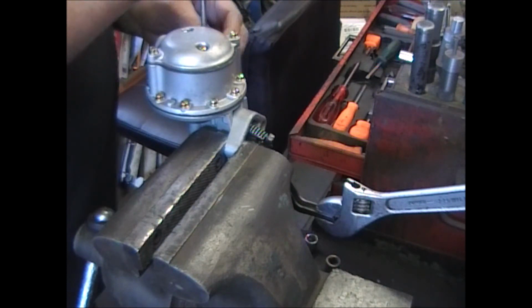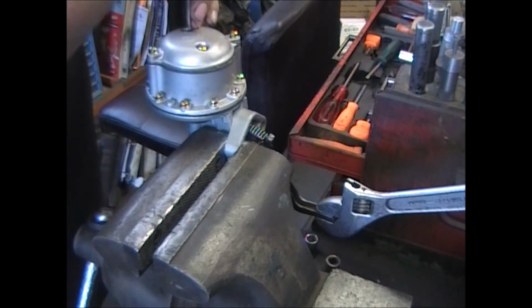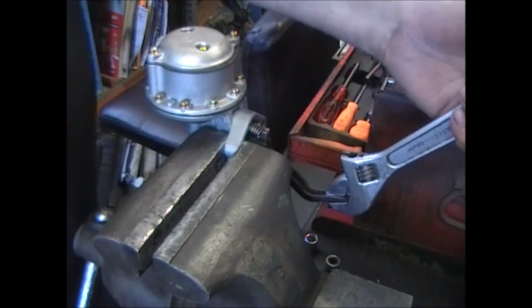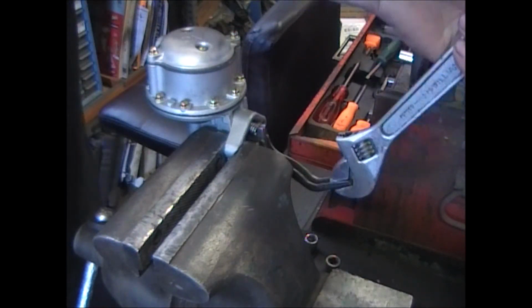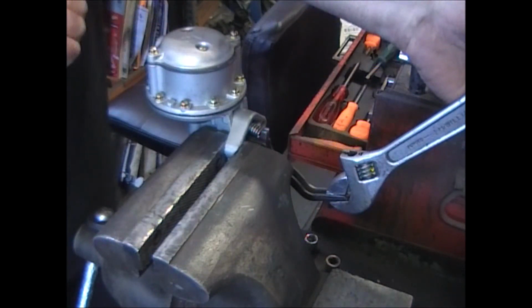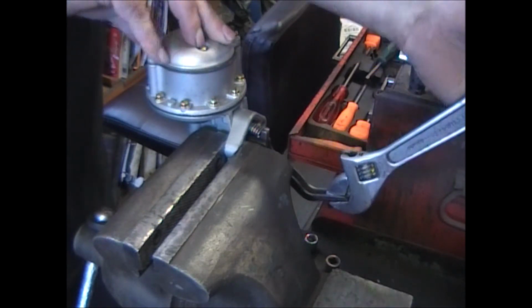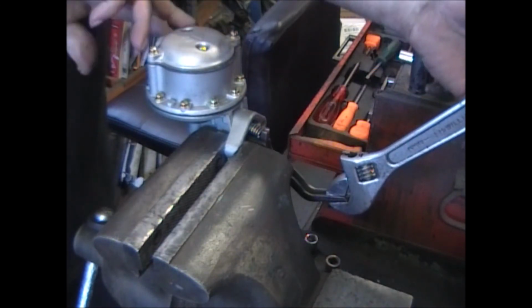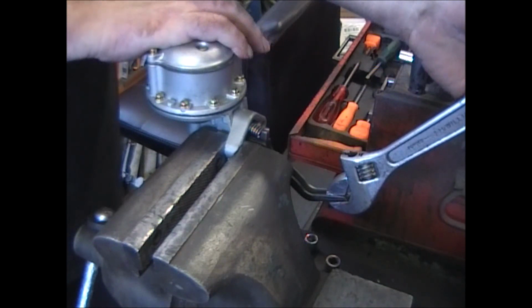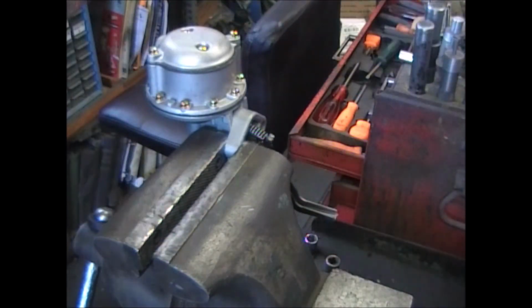Double check the top ones. I'll take that arm again. Make sure you got movement there, and you can hear them. Put your finger over the out, block the outlet, pull it up, and let the arm go. You should feel pressure there. With it released, put your finger over the inlet and pull out. You'll feel suction. Pump's ready to go.